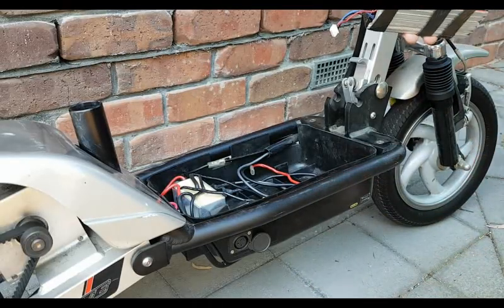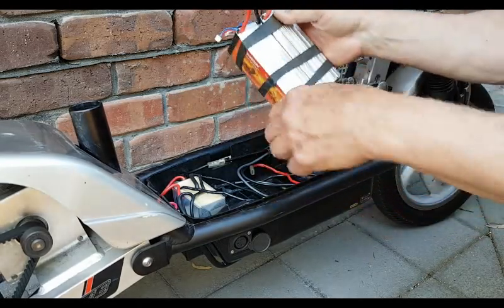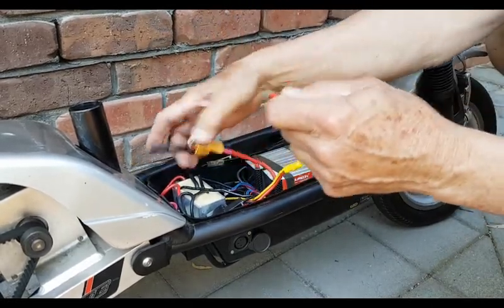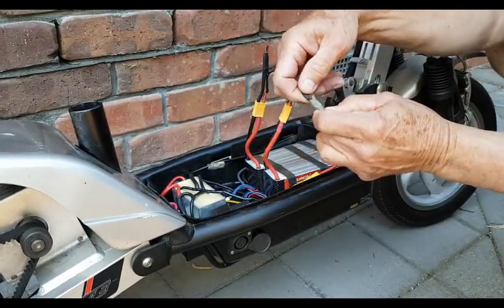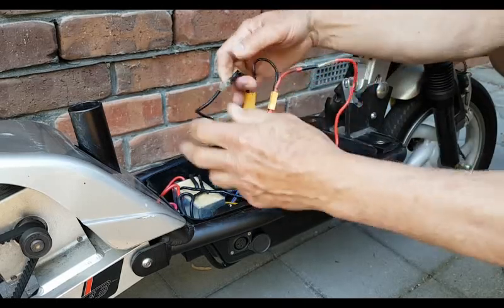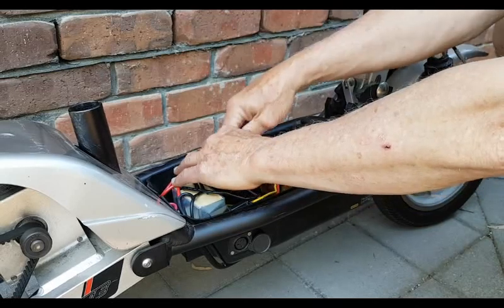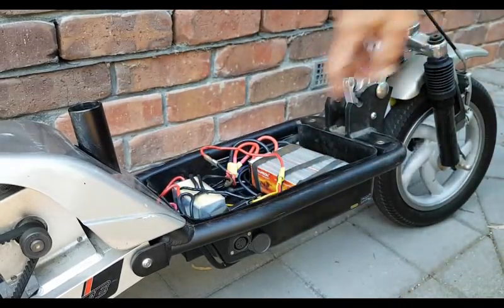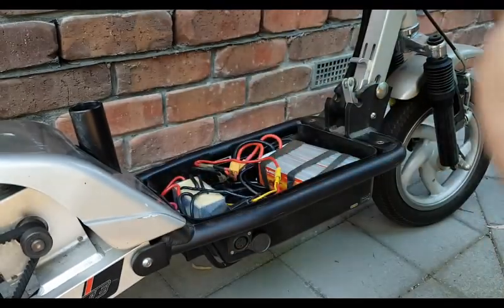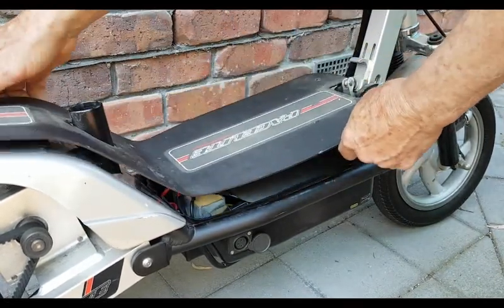Now, one problem with this is that you've got to be able to charge this. And once it's in there and you put the lid on, what do you do? Well, I'll show you. Anyway, these are the connectors from the scooter. I've made a kind of a temporary connection thing here just to see that everything works — a little blade that fits into the bayonet connector on the scooter. These are positive and negative. The wires are a bit unwieldy, but they do sit in there nicely. Batteries go like that. And I do put a little spacer in there to stop the battery from jumping around when you're riding it.